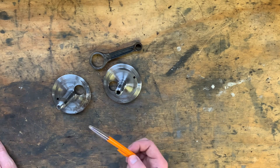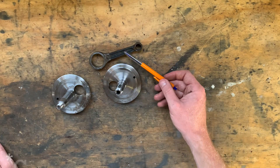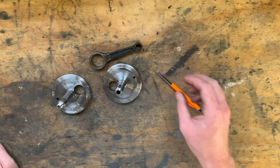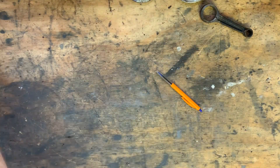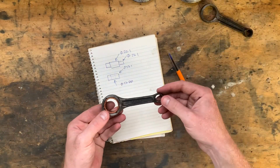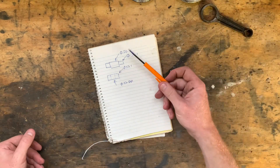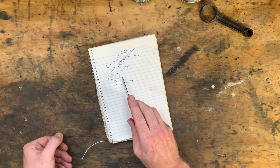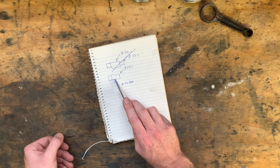In the meantime, I've ordered two of these from China — 30 bucks a pop. They'll show up and then I'll make the pin to suit. I had some junk 110 rods but they run on 25.1mm so that's scrapped. What I think we're going to do, if we have to, is have a 23.1 millimeter pin and it's going to be relieved in the center.